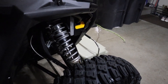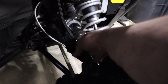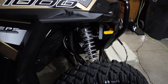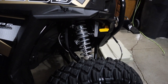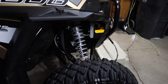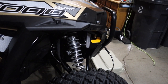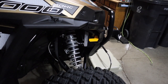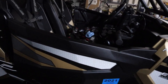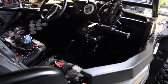If you've ever crawled with these things, Polaris — and my Can-Am as well — they thump really bad. What I've done is added limiting straps to the front end, and that's really helped avoid the piston bottoming out in the shock body and creating that big thump in the front suspension. Not an expensive mod, well worth it. It's nice and quiet and prevents that piston from just getting beat to death in the machine.